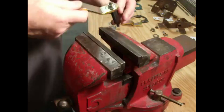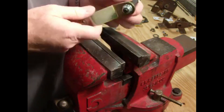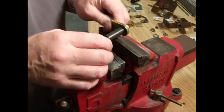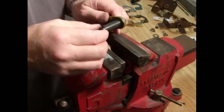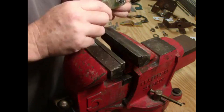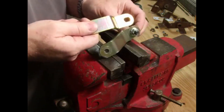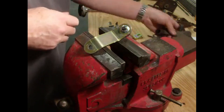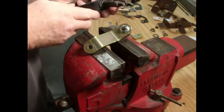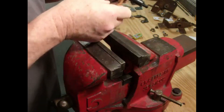This is a Nova shifter — later on GM cut the bottoms off, as you're seeing here. Now we're going to begin the reassembly of the shifter starting with the shaft, which has two different ends. The larger diameter end is for the handle; it's been cut down on the other end for the shift works offset arm. You'll get a couple of offset arms in your kit. The original ones were all peened and welded and didn't offer a lot of flexibility — people usually had to bend them.